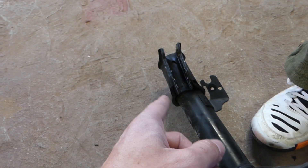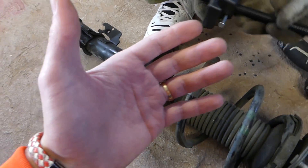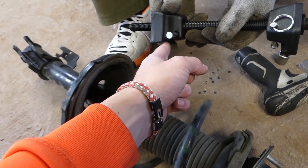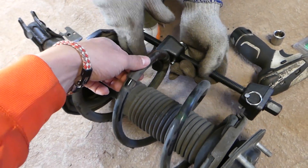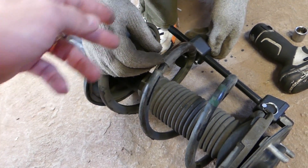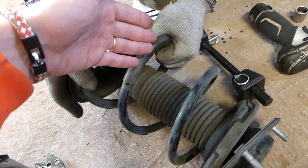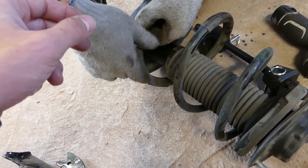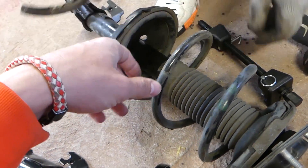The other vehicle was in an accident and you can see the strut is bent, so it's done — not fixable at all. What we're going to do now is pull the arms to the back so we can get the compressor on the spring, and after that push it in. The only problem is that plastic tubing here — it makes the spring a little bit wider and harder to push. So we'll remove that plastic tubing now and reinstall it once we're done.